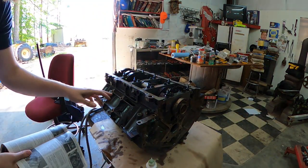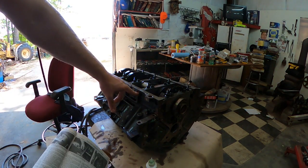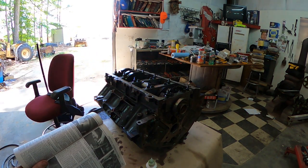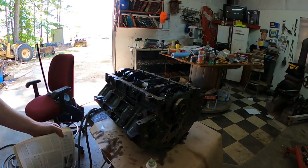But yeah, don't forget it. I'm going to reuse the side bolts, but I'm going to put high heat silicone on because they will leak, as it stated. So unless you got new bolts, you're okay. Other than that, you need to put silicone on the sides.